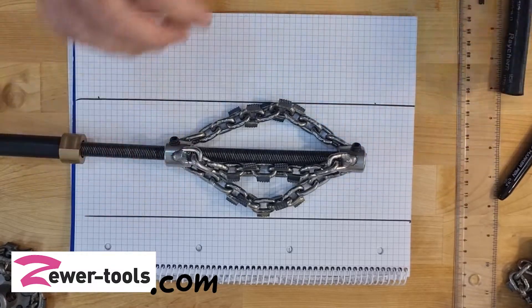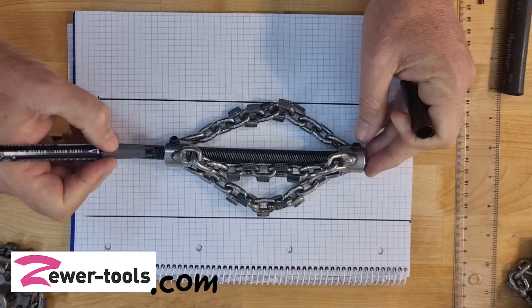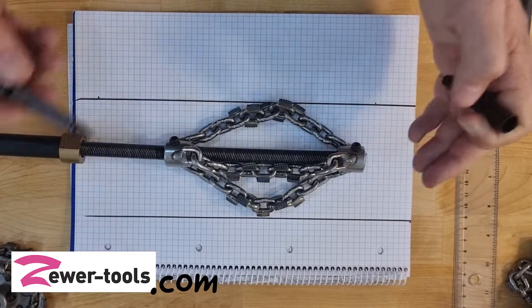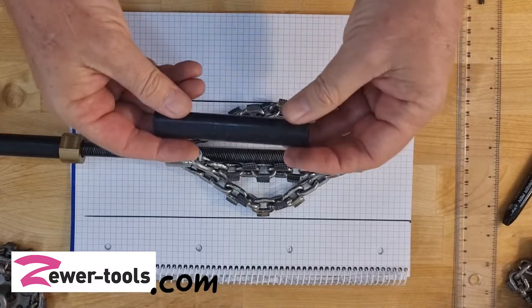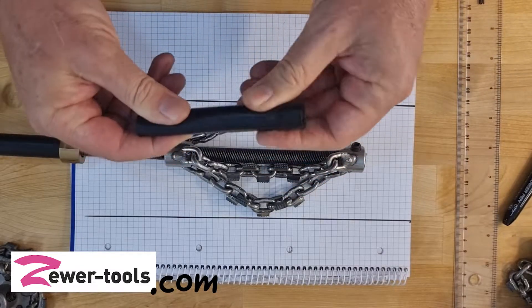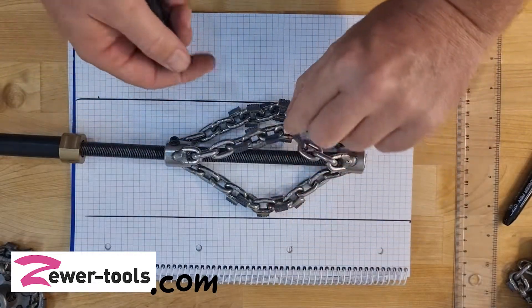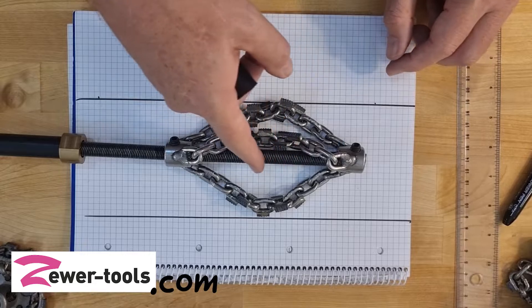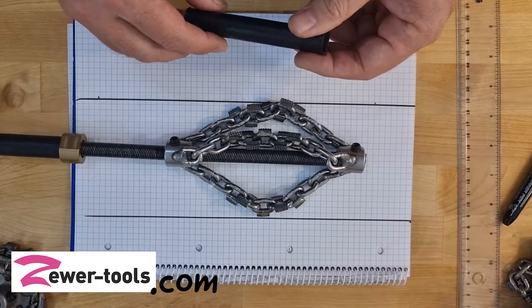At that point I'm going to use my marker pen and make a little marking on it so that I remember where that was. Personally I like to use a little piece of PEX pipe to protect my shaft from blows from the hard metal bits against the shaft — whilst it's not necessary, it's just a personal preference of mine.